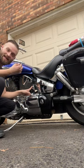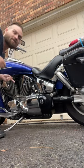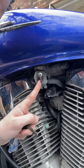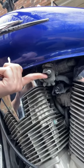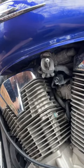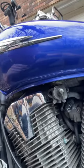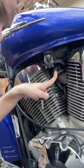Right here is where the key goes. F is for Fuel — the fuel lever is right here. You want to make sure that this is in a proper position. Some of them have your primary tank, your reserve tank, and off. For me, if I flick it forward, that means it's off. If I flick it like that, it means I'm using my reserve. If I flick it down, it means I'm using my primary. Right now it's in my primary tank. Your reserve tank is going to be all the way down at the bottom end, but all the way up here is your primary tank. So that took care of F.